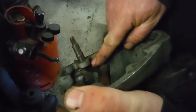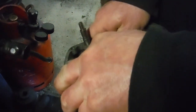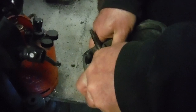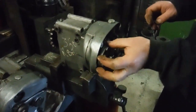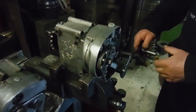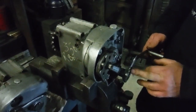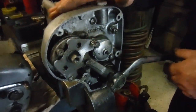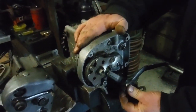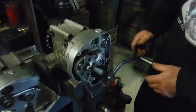When that spring-loaded plunger engages with the notches on the gear operator, we want precision selection and movement of that lot, which brings us to this here. Now, when I select the gears using the gear lever pedal, the observant among you may notice there's no kickstart shaft on this anymore. It was cut off because this is actually an early gearbox from our 350 racer when it was a bit of a tail end Charlie, but that doesn't really matter.